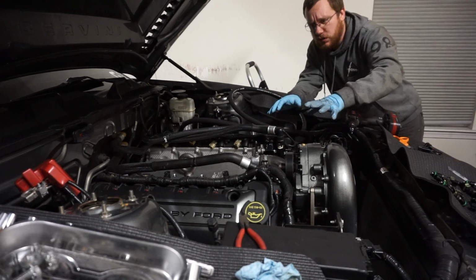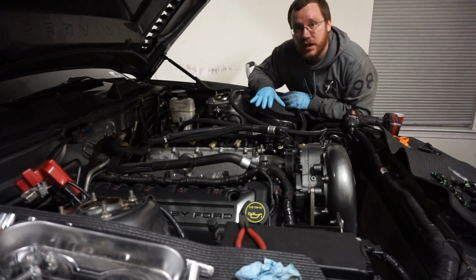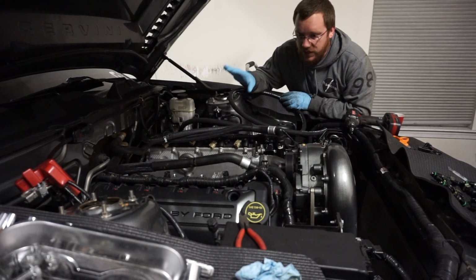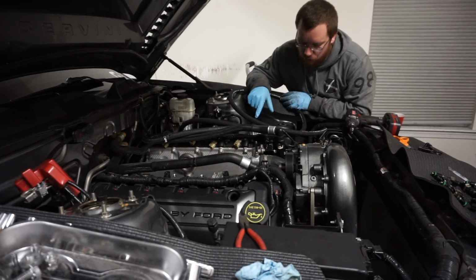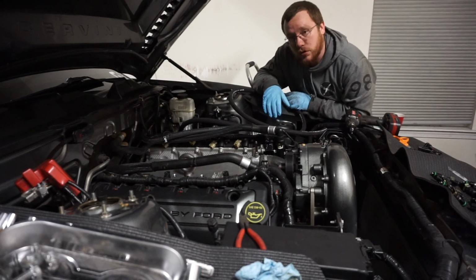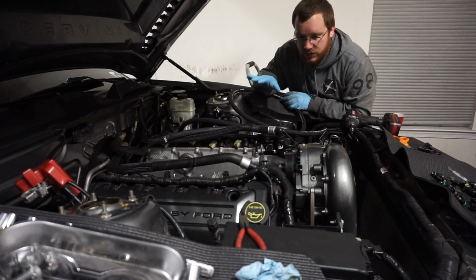It was a little bit difficult getting the motor lined up because I tried to bolt the transmission down, but I figured out that it was about a quarter inch to one side. I basically had the back side supported by the jack, and then loosened the motor mounts up front, took the crowbar and wedged on the motor mount itself, and I was able to shift the motor to the passenger side that quarter inch or so. Bolted all back up, everything lined up perfectly at that point, so then it was good to go.